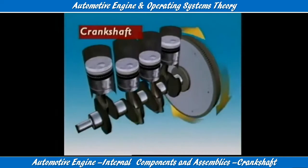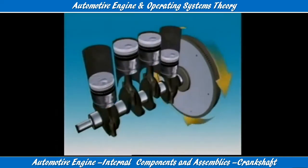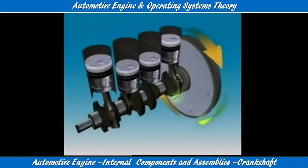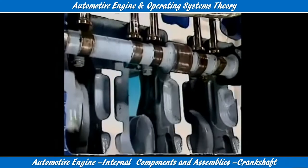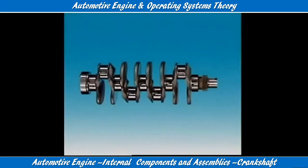This section examines the crankshaft. The crankshaft is attached to the connecting rod in offset areas called throws, where the downward power pulses change into rotating motion. Crankshafts must be strong enough to do this without bending or twisting.